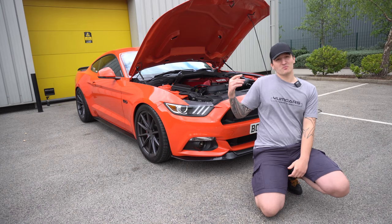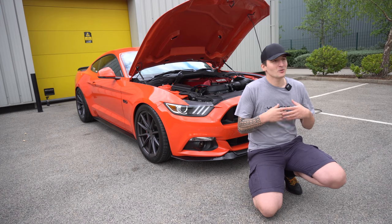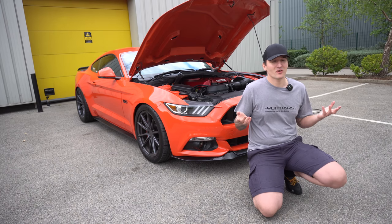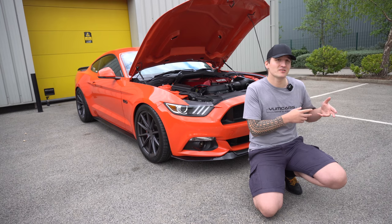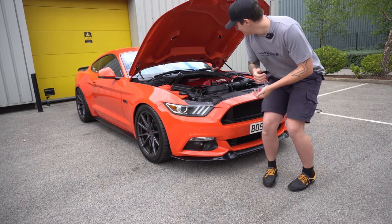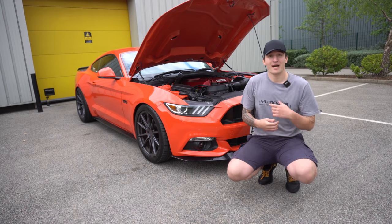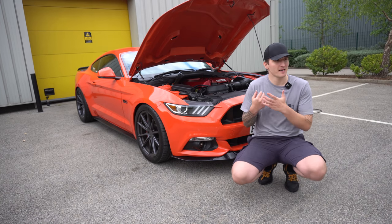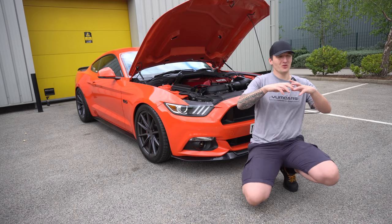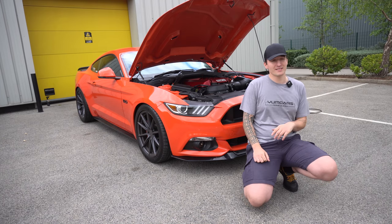Because this car is modern, if your car is any older than say 99, 2000, so 2000 and onwards, you should be completely safe because all the connections and everything else in the engine is what's called splash proofing, so the engine is splash proofed. I always say that if you drive, say, on the motorway at 70 mile an hour in the rain, come back home, open up your bonnet and have a look, your entire engine bay is saturated in water anyway. So as I said, it is splash proof and it's totally safe.